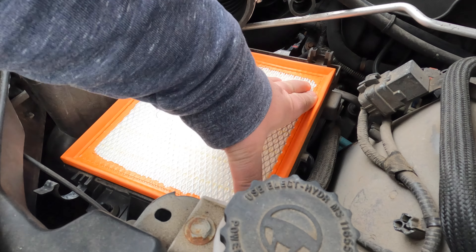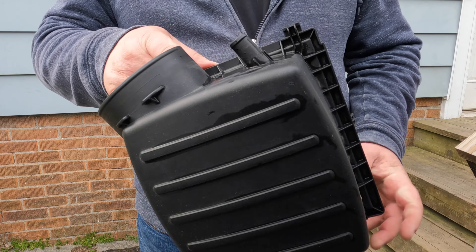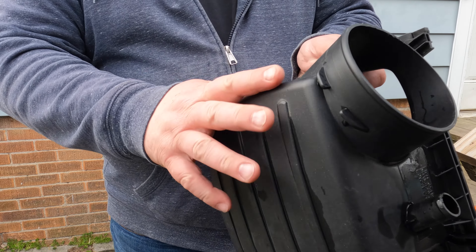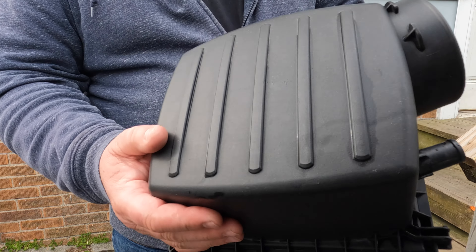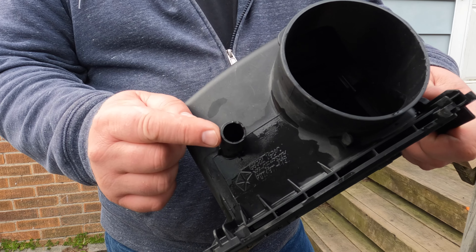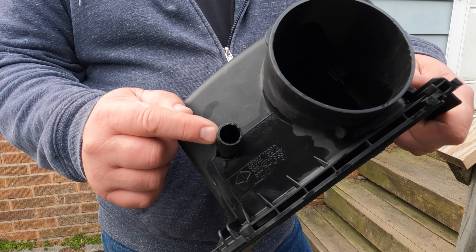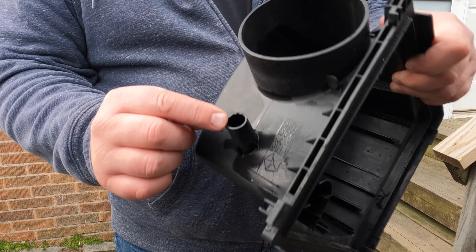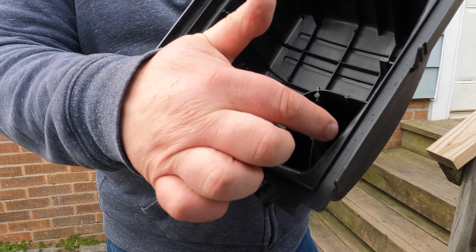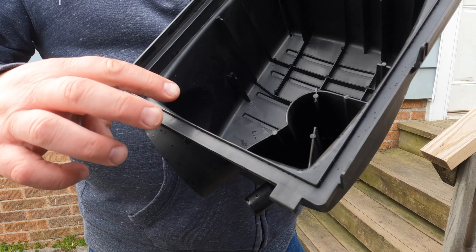Mike, maybe you can explain this part? This is the clean part of the air intake — where clean air is residing. We need to make sure that there is no crack or anything in this; it is intact. And then here, it is sucking in the crankcase air. The crankcase ventilation is going in here, so we are going to have to make sure that there is no oil in there, there is a clean hole in there, and there is not too much oil collecting inside here. If that is the case, we need to check out if our crankcase ventilation is good or not.